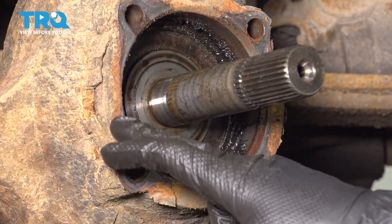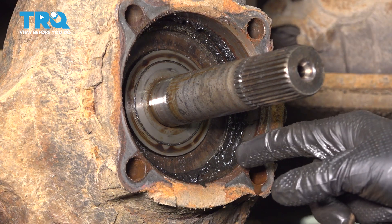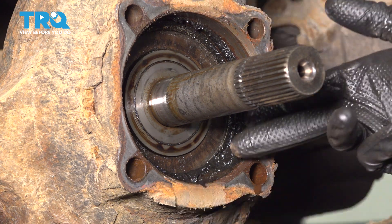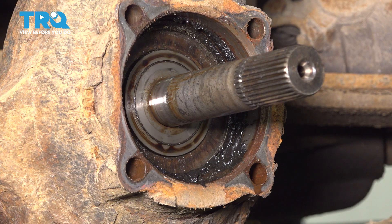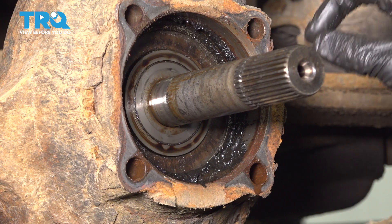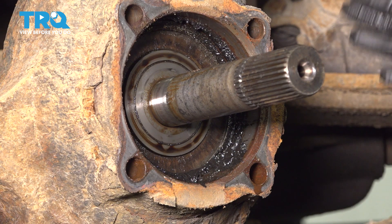What I'm going to do now is clean off the area around the knuckle here and remove this grease because it's very old — I just want to pack it with new grease. But if yours is fresh, I guess you could leave it. However, cleaning this will contaminate the grease, so regardless I'm going to have to remove it anyway. I'm going to clean this up with a very fine sanding disc — I don't want to remove material, I just want to get the rust off and flatten this. Then we'll coat this with some anti-seize, pack it with grease, and put in the new wheel bearing.